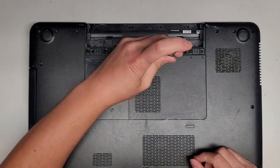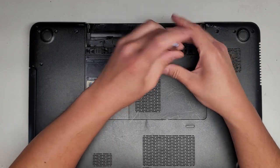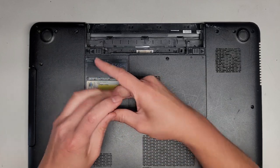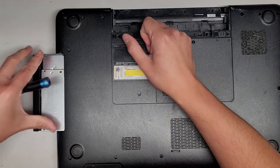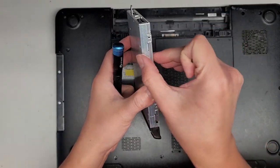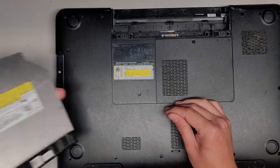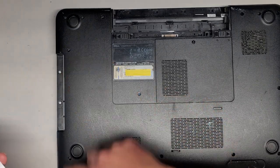I'm not gonna do a complete disassembly on here — we're just gonna do a quick look of what's going on under this little door. There's one screw holding this optical disk drive in there. You can see the optical disk drive; this is one of the thicker ones, like 12.7 millimeters thick. If you want, you can get a hard drive adapter and replace the CD drive with a hard drive or an SSD.